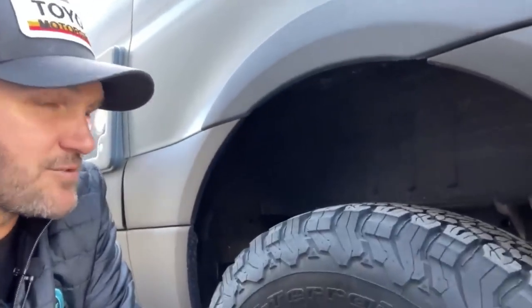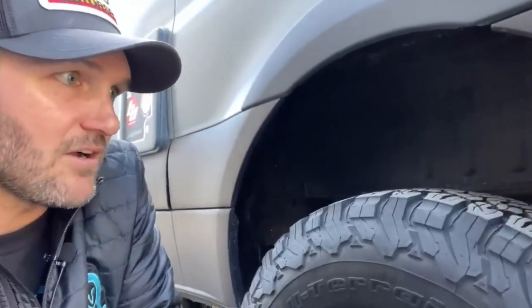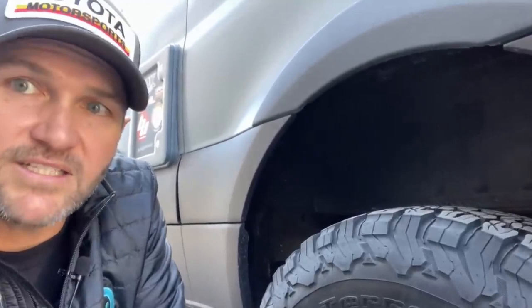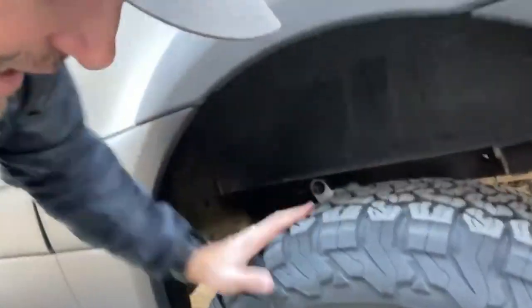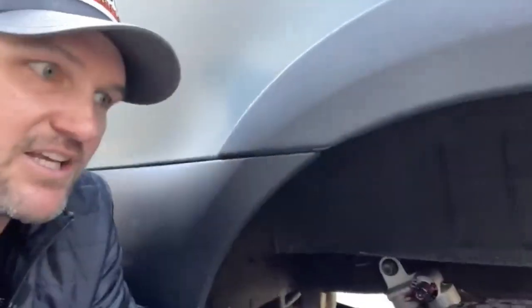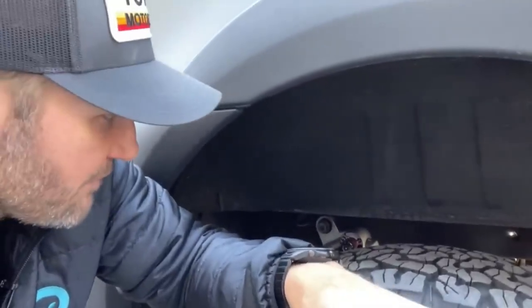Both are springs. They have advantages and disadvantages, but both essentially do the same thing, which is suspend the weight of the van above the axles and the tires. Now, the shock, on the other hand, is actually not contributing to the spring rate of the vehicle. What the shock's doing is actually counteracting the spring in some sense.